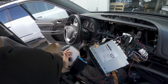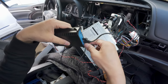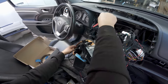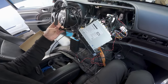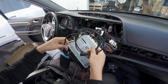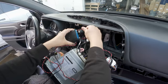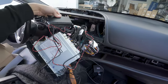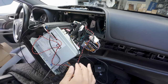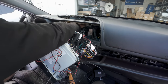We have two more connections. One is the antenna — this is the antenna for your wireless CarPlay Android Auto connection to this module, and we will route this down below to the driver's side, going left and down. The USB extension cable that comes with it you don't need if you use this additional optional harness adapter. If you don't get the optional adapter, you could connect this here and route it to your desired location — most likely your glove box. And lastly we have the HDMI cable, which connects between the two boxes — one mounted here and one mounted down there. This is specific for the JBL; if you have the non-JBL you can mount both boxes behind the radio in that cavity.